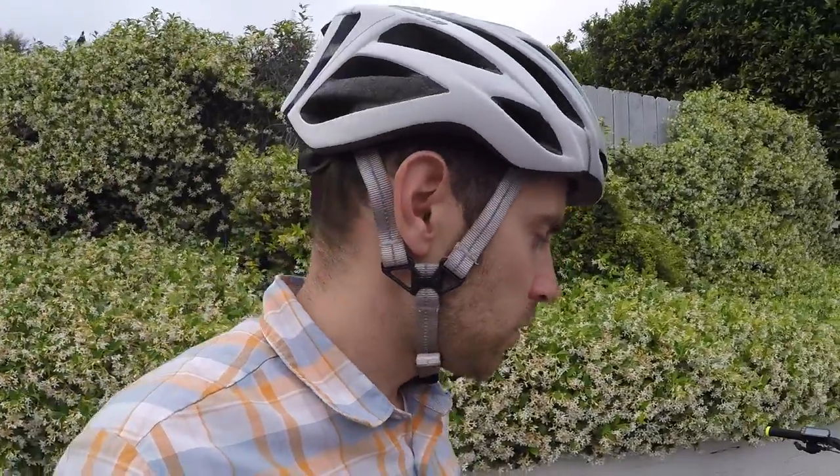I'm not worried about losing traction on these streets, but I was climbing the hill and it was like, yeah, I'm getting some more power. So you might not get the same range, in part because these are big knobby tires and there's two motors pulling off that battery pack, but it did help me. My experience riding in snow and slippery conditions is that front wheel drive, that pulling, does help to keep you on track versus just being pushed forward and potentially sliding out like that.